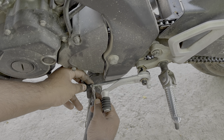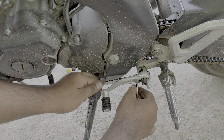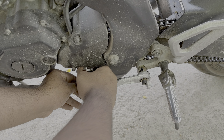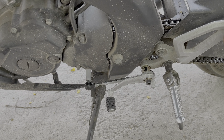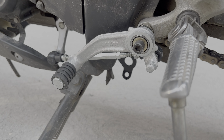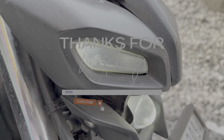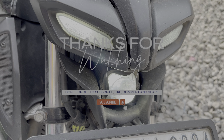After making the necessary adjustment, tighten the lock nut as shown — do not forget to tighten the lock nut on the opposite end too. Then tighten the lock nut on the gear arm and also on the gear rod where it meets the gear lever. Finally, tighten the 12mm bolt, which completes the entire installation. Now you can enjoy smoother gear shifts and shift more aggressively. This modification is applicable for all MT users, R15 users irrespective of version, and FZ users too. I hope this video was informative — if you liked it, consider subscribing to Apionics and follow me on Instagram for more content.